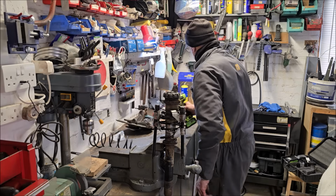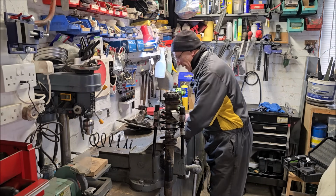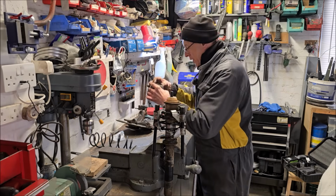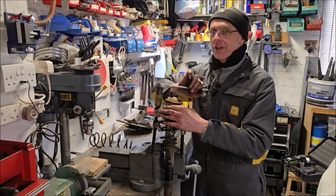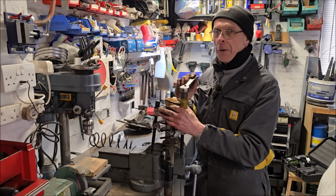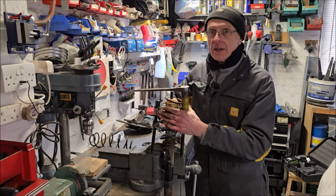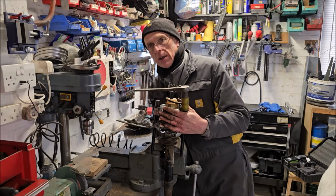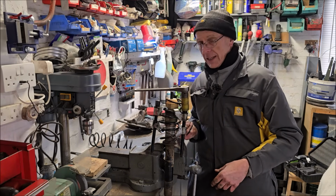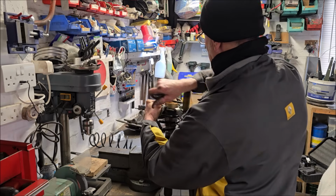Boing! Right, John boy. Time to keep your young brain on the job, because being an old and senile old git, I'm liable to forget how everything goes together. Spring me on. Part 1, Part 2, all in one go. That special tool is, if you were doing these all the time, you'd have one of these. You can buy a cheap version, which is nylon, because some shockies always fly in. It stops them from flying down when you put them together, so you can clamp it to stop it doing that. But that special Mercedes-Benz smart tool is the right thing to have, isn't it?